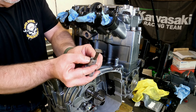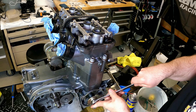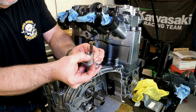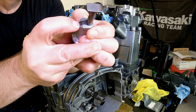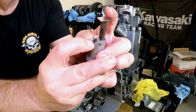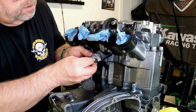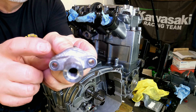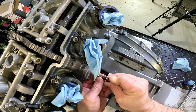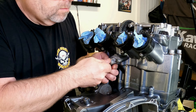With the cam keepers torqued down to 12 newton meters, I can now reinstall the cam chain tensioner. Do not rotate the engine crankshaft and cams without the cam chain tensioner in place — if you do, it's highly likely the chain will jump on one of the sprockets and throw the whole engine out of time. The cam chain tensioner on this engine is a simple spring and plunger type with a ratchet mechanism to prevent the plunger from retracting once the engine is running. To start I need to get the plunger back down to the retracted position by moving the ratchet stopper out of the way and then pushing the plunger back down all the way in. I can now install a new gasket and my tensioner in the engine block. The tensioner only goes into the block in one direction — there is an arrow stamped in the casting of the tensioner on the top side. With the tensioner torqued down, I can install the spring guide pin and bolt cap after replacing the crush washer on the bolt. The spring will move the plunger back out against the chain, but you may have to rotate the engine over a few times to get the chain back to full tension.